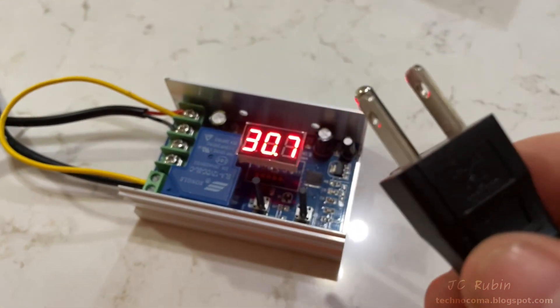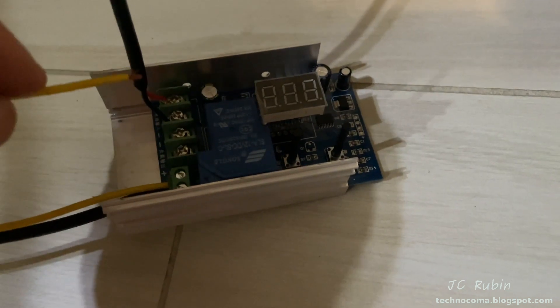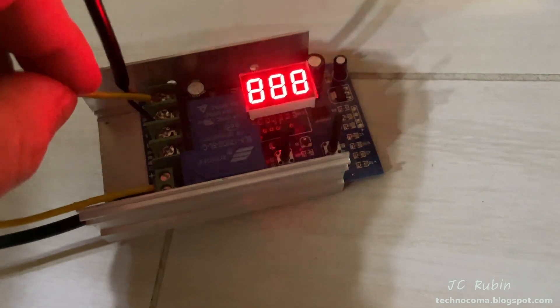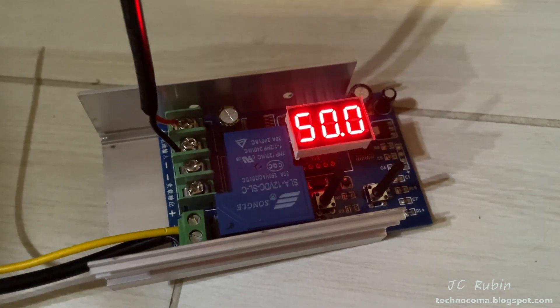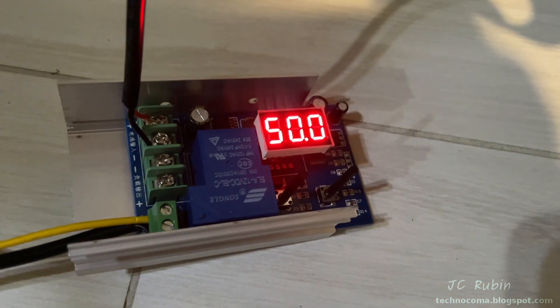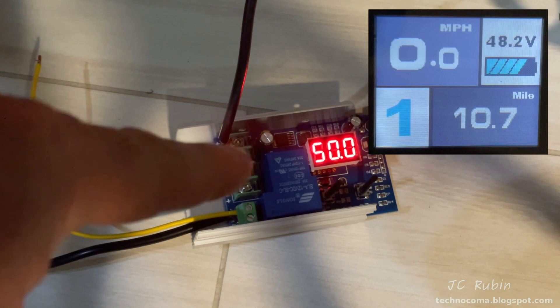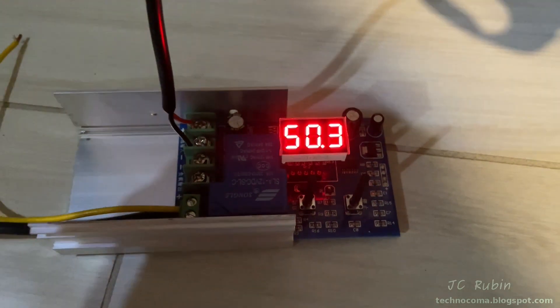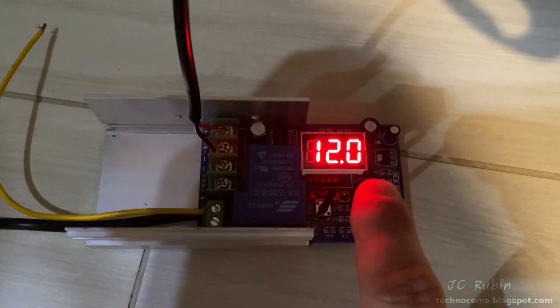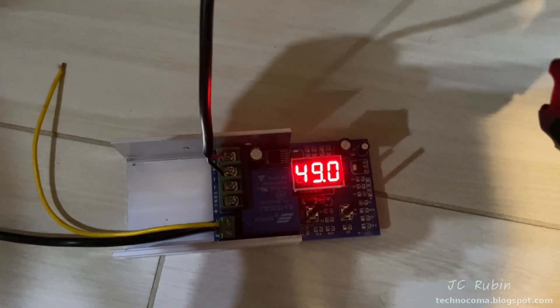The second problem is that my charge controller in the bike won't show battery voltage until it sees a voltage on the charger, and this charge controller won't turn on until it sees a battery voltage — a chicken-and-egg situation. I have to briefly touch them together to get both to turn on. This isn't ideal; ideally you'd bridge across before connecting the battery, then disconnect the wire. Using a bypass switch you can see everything turns on and operates normally, showing actual battery voltage. The two meters differ by about 1.8 volts — not great. I raise the minimum cutoff voltage from 12 up to 49 volts, which isn't ideal but is good enough for now. However, I later realize I made an error during charging.